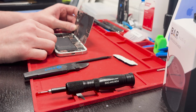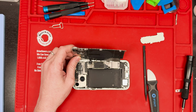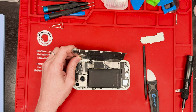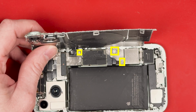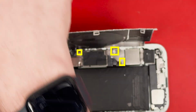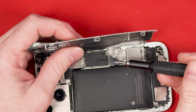And anyways, we will grab our Y000 screwdriver and unscrew the 3 screws holding down the brackets, holding down the battery connection and the back glass connection. The Y000 screws are in yellow, and I want to point out, throughout my channel, I have color-coded screws, so it makes it easier for you to remember which screwdriver to use for which color.